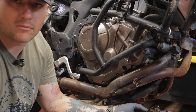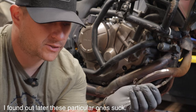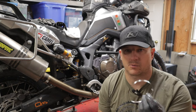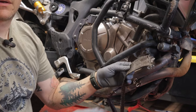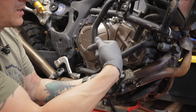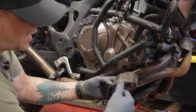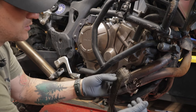The kit comes with stainless steel zip ties, which are pretty nice. Another option is stainless steel safety wire — it's a lot thinner and less visible, though these zip ties will show. You'll definitely want to use one at the beginning and end, and maybe a couple more at bends to hold everything snug. For the first piece, start with it folded over and trim the frayed bits. Your first couple of wraps will have a bit more overlap; after that, aim for half to three-quarters overlap. Just go slow and be patient — this stuff does fray fairly quickly.